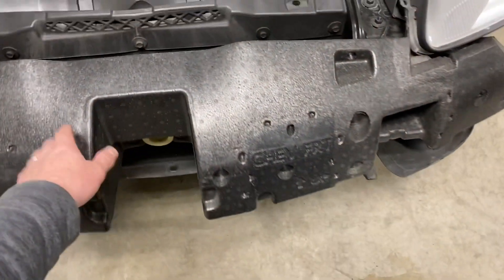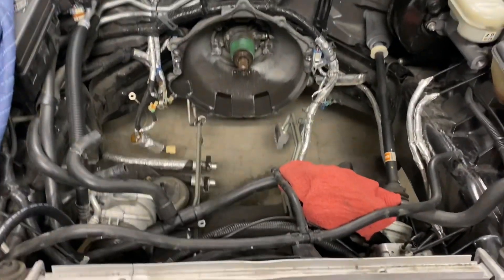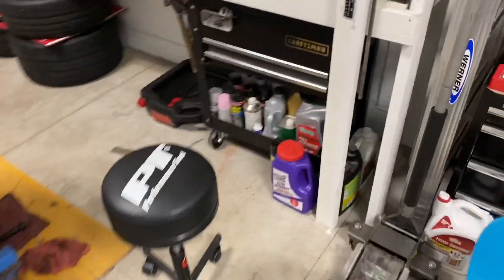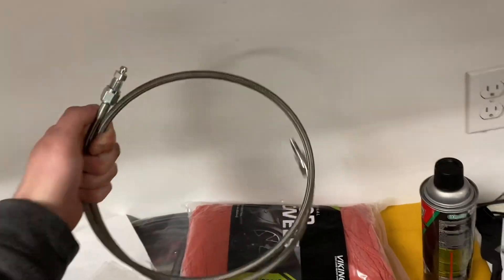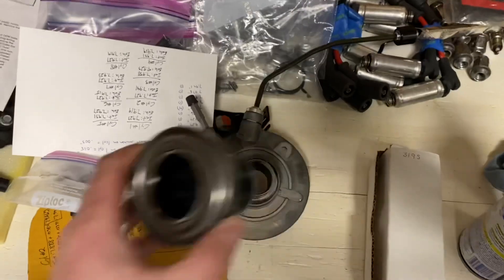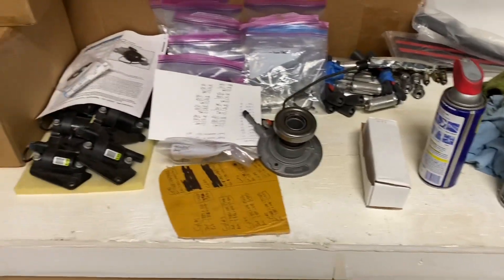We're back up to current day and I'm finally getting ready to do the last couple of things I need to do to get the engine in the car. The first of which is I need to pull this radiator out — I pulled the front bumper cover off and I'm going to pull this impact styrofoam out just for some clearance for the engine hoist, so I have tons of room for dropping the engine in. I'll be replacing the slave cylinder and throwout bearing. I also got a remote clutch bleed piece here — I'm going to be installing this remote bleeder because it's very hard to bleed the slave cylinders on these cars when the engine, torque tube, or transmission is in. And I've got the new slave right here with a billet throwout bearing — very nice stuff.